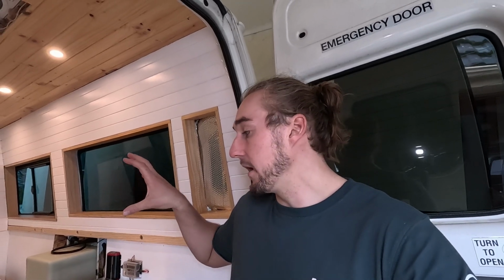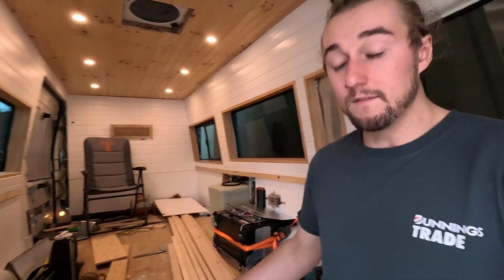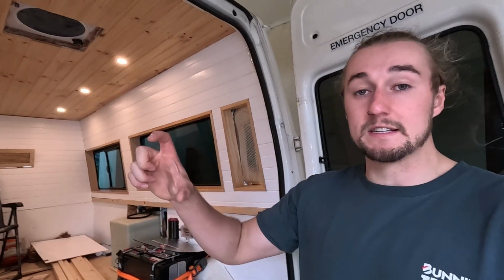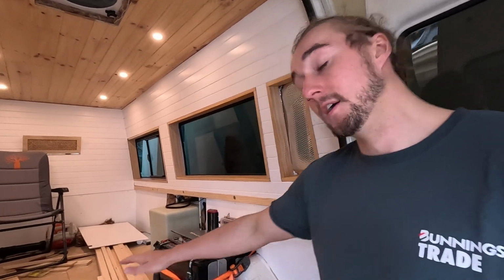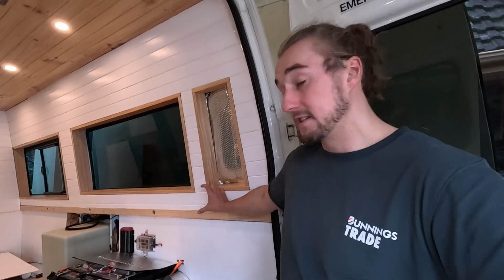And ultimately, I want a really nice area to hang out with people when we're away on trips. The most difficult part of this job is going to be keeping in mind all the little measurements we need to keep the area functional and ergonomic. We're gonna have a little pull-out table at the back here. So I need to raise the floor in the middle about 70 millimeters to factor in for the drawer sliders, which means when designing the height of the couches, we have to factor in the raised floor as well as the height the mattress is gonna sit on the finished bed.